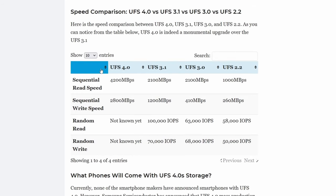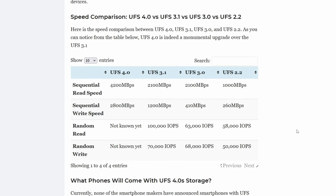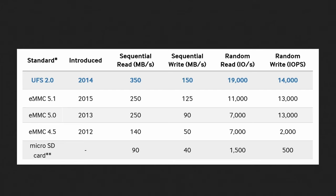I really hope that Retroid finally makes the switch to UFS storage. EMMC is pretty slow and we're noticing that with a lot of these cheaper handhelds — very slow boot speeds. It doesn't bother everyone and most of the time you can just hibernate the device, but having UFS 2.1 and up would mean faster boot speeds and faster game loading. Current EMMC storage runs at only around 250MB read and 90MB write, and the random read and write for loading games is also pretty slow.